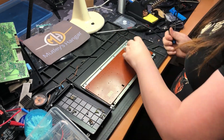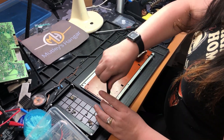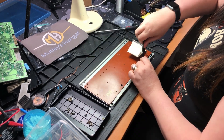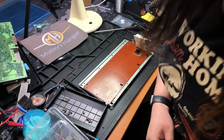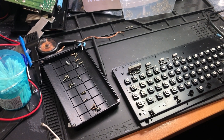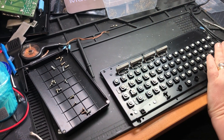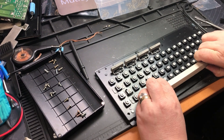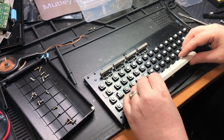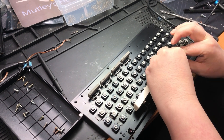The first job we have to do is replace that missing dome key cap from the up arrow. If you remember from the first video, the up key just kind of looked a little soft — well, it was because there was no cap in there. Then all I have to do is screw the entire back plate back on, and there are many screws. Then it's on with putting the keys back on the keyboard. Here it's just best to take your time because some of these keys are going to be fiddly, especially the latched ones. Make sure you've got an image of the keyboard — I did, because I was very unfamiliar with a few of the key positions on this old machine.